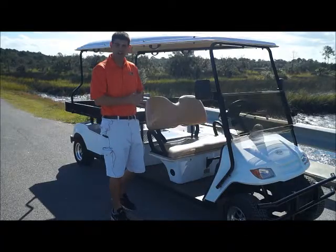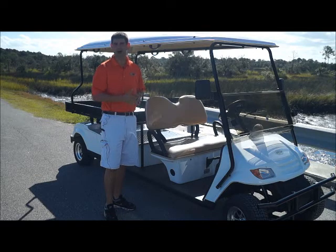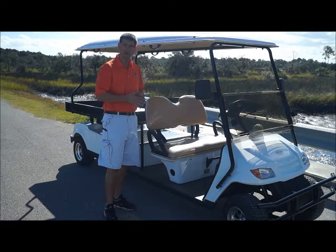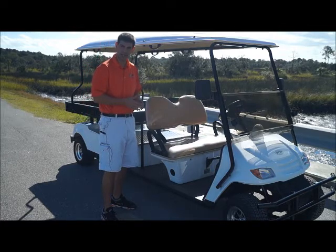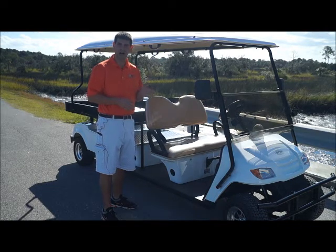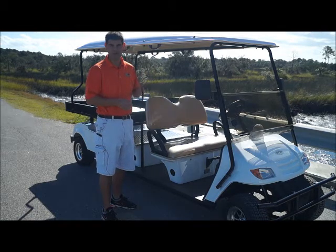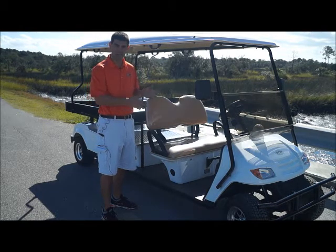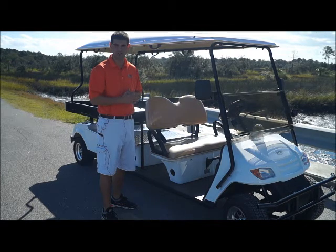Here we are at the front of the golf cart. There are a lot of good features that a lot of golf cart companies don't include and I frankly don't know why. First off, we've been using a hand operated mechanical parking brake. On golf carts where you just push the pedal down and lock it into position, if your brakes ever fail, you have no safety net on your brake line. So we've been separating the brake lines, giving you an independent parking brake — just another safety feature for when your drivers are using the vehicle.